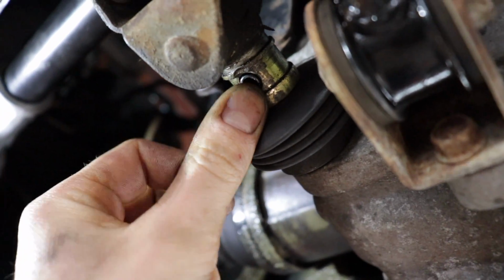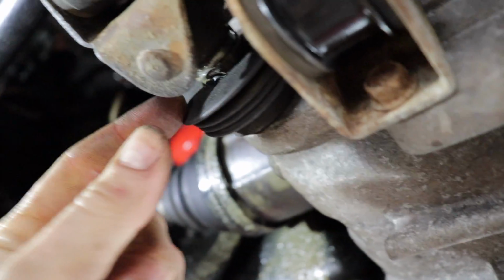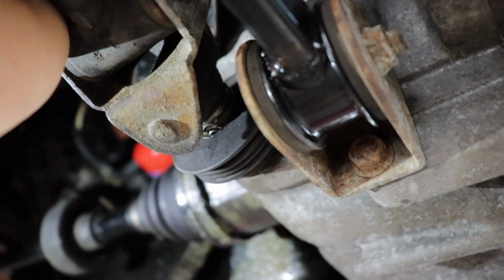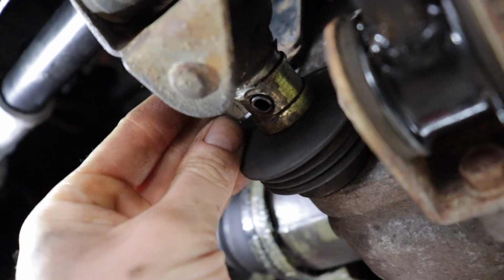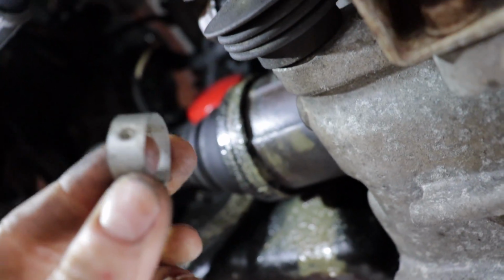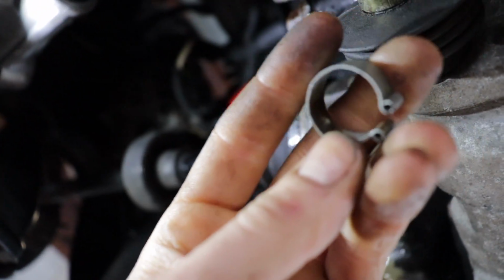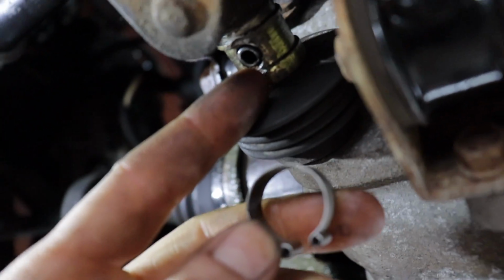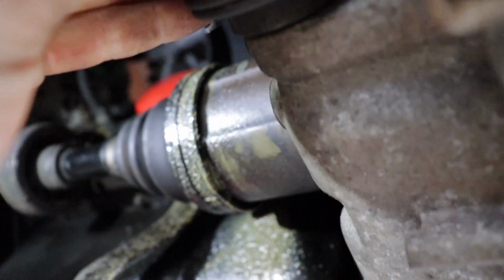So we got the drift pin back in, just start it and then hammer it back in. You gotta have the linkage, because if it's forward, the boot covers it up. You can't get to it, so if you pull it back, then you can take the boot out. And then hammer that in with the same tool that you got it out with, and then make sure the flat spot, well, it doesn't matter if it's top or bottom, but that bump there will actually sit inside the drift pin, so it keeps it locked down. So you just rip on it.